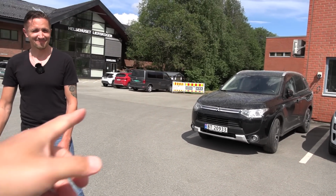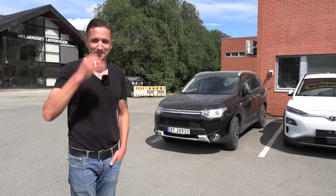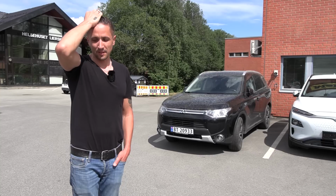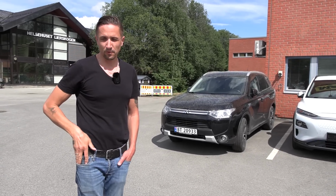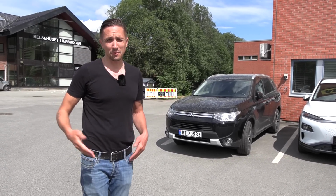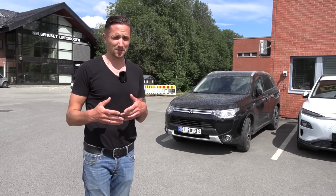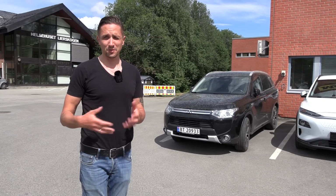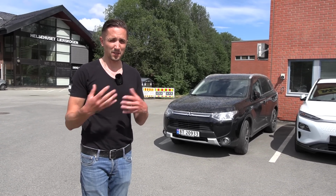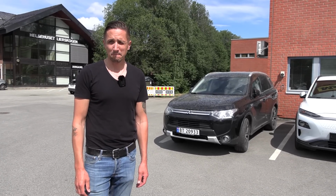Well, okay, I wonder something. When you have plug-in hybrids, if the electric system is kaput, can you still drive the car? No, it's indicating EV fault, and the car doesn't want to move. Maybe it depends on the problem, because those 2 were isolation faults, so I think it's too dangerous to close the high voltage contactor, so that's why maybe the car doesn't even want to start. Man, I mean, what is the point of a hybrid then?